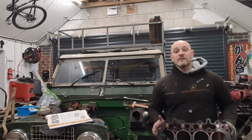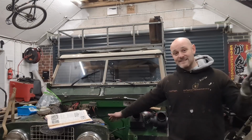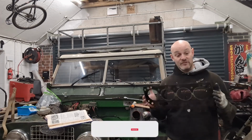Guys, that's where we'll wrap up this video, to be honest. Off camera, what I'm going to do now is clean up the face of the block and the cylinder head, ready for the next episode when we'll start refitting with the new head gasket, head bolts and everything else that goes with it.